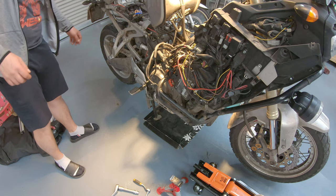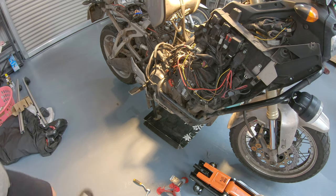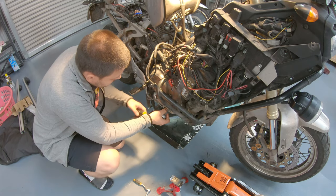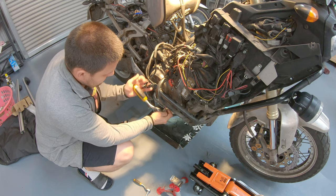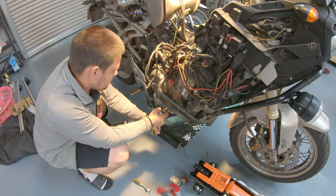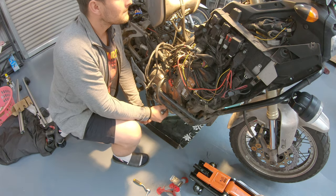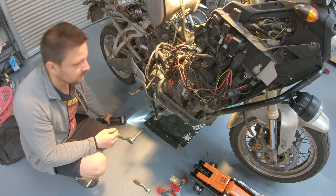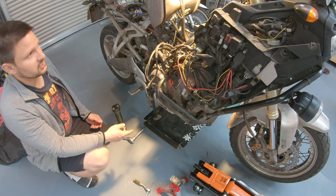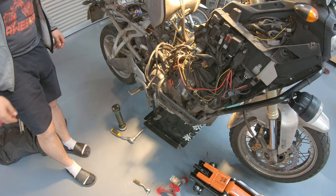So we need to spin the engine twice, 360 degrees. I did spin it already once, and we take another measurement of cylinder number one. Let's see, we start here and go around, and we should come back to the same position, but now the thing slipped, so we need to be careful. Almost. And so twice 360 degrees, so two rotations, and cylinder one will align again the same way it was before. T will be pointing forward on the crankshaft.